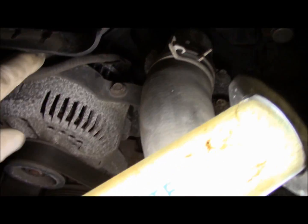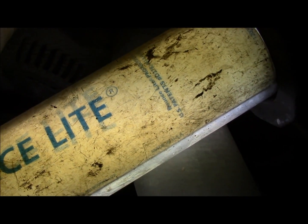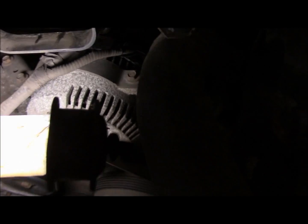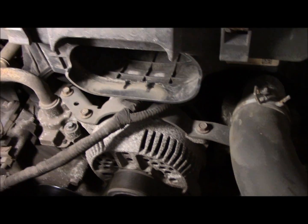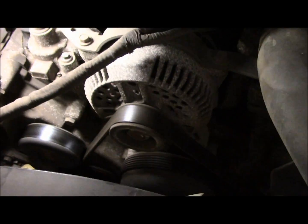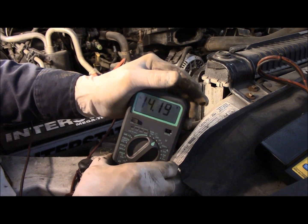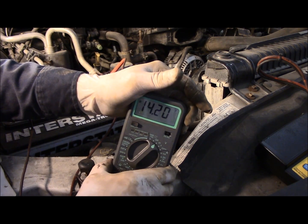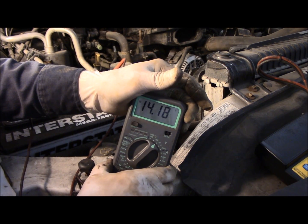Now, being that this condition is intermittent, we're going to make sure we check all of these leads to make sure there's no damage. I can see the positive is actually a little bit oxidized — it looks like it's green inside there. We'll take a closer look at that when we take it apart. So now we're going to change the alternator. As always, thanks for watching. Any questions or comments, send me an email — I'll be happy to talk to anybody about anything. Thanks for watching, and I'll see you on the next one.